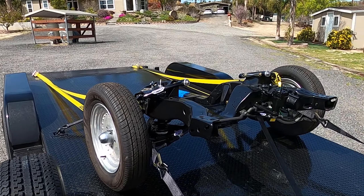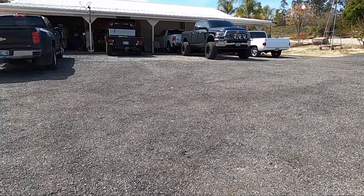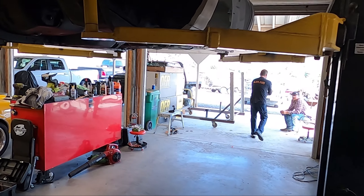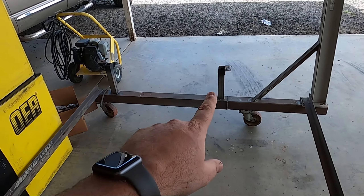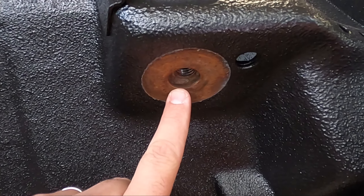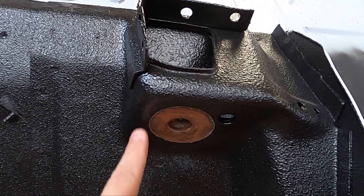We made it out to Craig's, up here at the ranch. I added like 50 straps so it was not moving. We just got the car off of its side — he just finished the last of the welding. We're going to roll it in and detach it from our makeshift rotisserie. We used the actual original leaf spring mounts, welded them to bars and bolted to the car, and the front mounted to the front subframe connectors using solid aluminum bushings. There's still a little rust we couldn't get from media blasting around those areas — we'll get these cleaned up, painted, and coated.